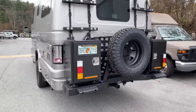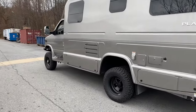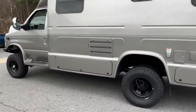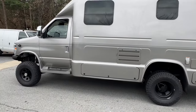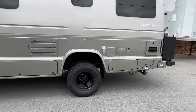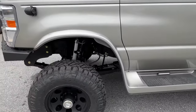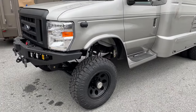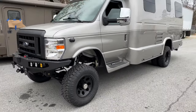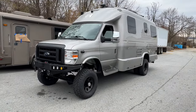Spare on the back. I get questions often about the different size wheels and tires in the front and the back. Obviously the overall diameter is the same — you've got to have that for full drive function. The spare is a rear, so in case of a catastrophic tire failure up front, tire comes apart, you can run the spare up front — you just run it backwards, so it's poked out. No problem, get you where you need to go. Catastrophic tire failures like that are pretty uncommon.